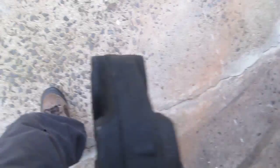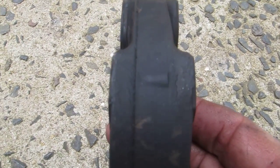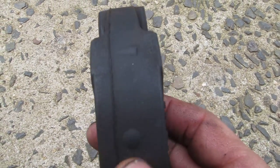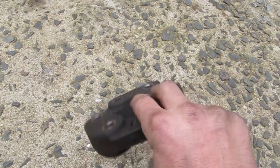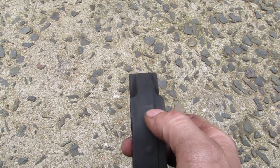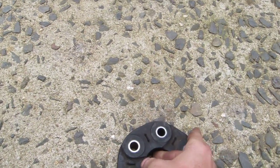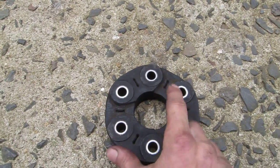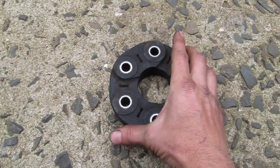Just so you know — if you look at these flex discs, you're going to see arrows around the outside. Watch this: one arrow is facing to the left, the next is facing to the right — they alternate. How they want you to do this: you can install the disc either way, but what they want you to do is take this arrow and make it face the transmission. If you do that, the transmission mounts to these three bolt paths and the driveline to these three — so now you have compression force when you take off, not stretching force.